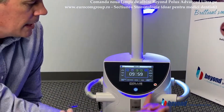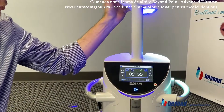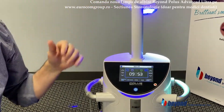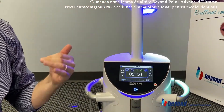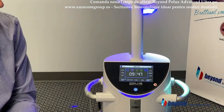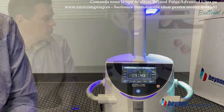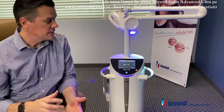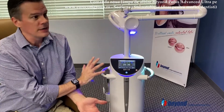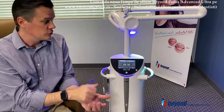As you look at the fan here, you can see it's turning — you can actually hear it as you get a little bit closer to the head itself. When the unit stops being used, the fan will stay on for some time afterwards. The idea behind that is just to cool down the halogen bulb to make it last longer. So please leave the unit alone and let it cool down by itself. It will automatically turn off once it's finished, and then you can shut it down for the day.